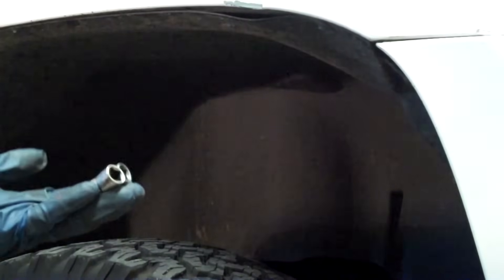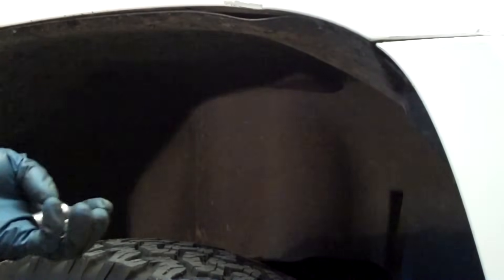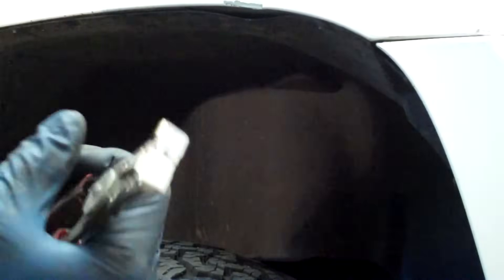The tools I'm going to use to get into the wheel well and access the glow plugs — we're going to do all eight of them. You need a seven millimeter and a ten millimeter socket. And then I like to use these — they're actually for a hose clamp, but I use them for body pins because they work awesome.